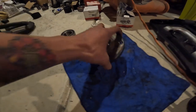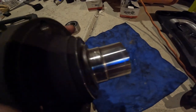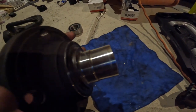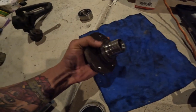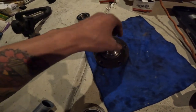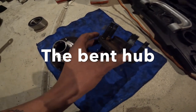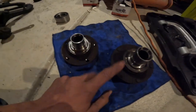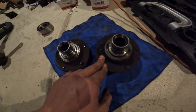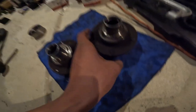The parts have been acquired, so I picked this up at the junkyard. I removed the bearing and there is a little slit in there - that's a sign that the bearing was already replaced on this hub previously. This is the one that I have. As you can see, I have my studs on it already. I did put a lot of red Loctite on these. I'm probably just going to hit it with the torch, heat them up, and try to salvage those because I need them to run my spacers so I can clear the calipers.